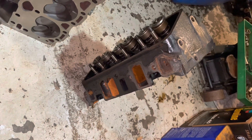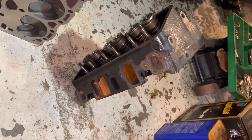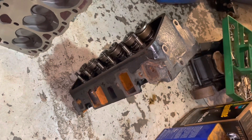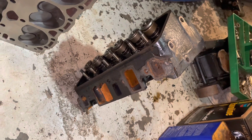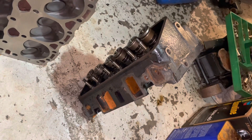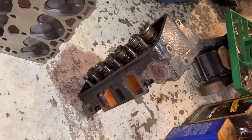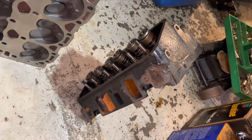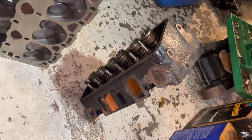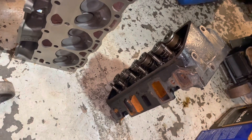When I say intake, I'm talking about carburetor intake. Because if you buy a 1996 or later car or truck Vortec V6 engine, you're going to get a fuel injection intake. They didn't use carburetors from 1996 up. GM never used carburetors on the Vortec car or truck engine, so you're going to get a plastic fuel injection intake — it's called a spider intake. It uses a plastic fuel injection system with what they call poppets. You can't use it in a marine application because the Coast Guard doesn't allow plastic fuel rails or fuel lines. That intake is not allowed in a boat.